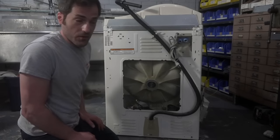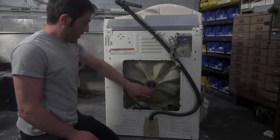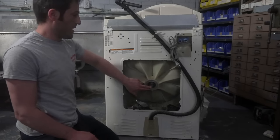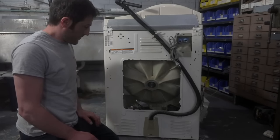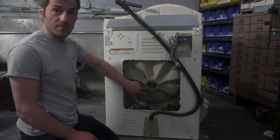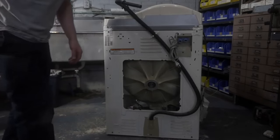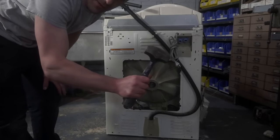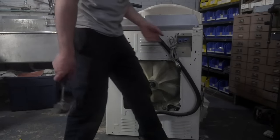Sorry guys, I'm open. So when the phone rings, I got to stop and answer it. So at this point, we're pretty much ready to go. I'm going to give this a little love tap just to free it up. And then I'm going to spin the washer around. Or actually, maybe I'll pull the tub out and then I'll get the bearings out from the back here because this might be a little bit better of a vantage point. So let me just... And I highly recommend using a 3-pound sledge. This is probably one of my most used tools in this shop.